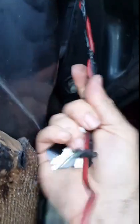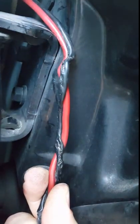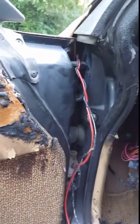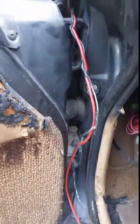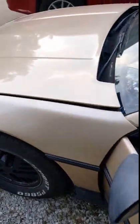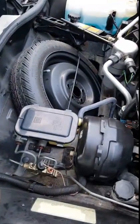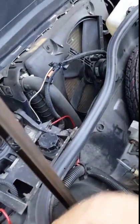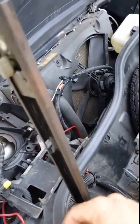And if you turn it on around backwards, you can see some wire sticking through there. So when this door was shutting, it was grounding the wire to the chassis, which is obviously not good, especially when you don't have a fuse on the circuit. It turns that wire into a toaster grid. So the wire was run through the fender and down here, and you can see where it comes out underneath the fender. The wire, this is going to be hard.